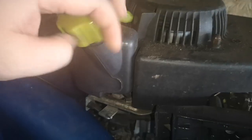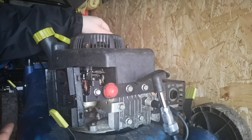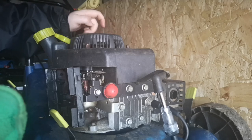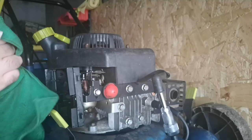So what I might do is put some petrol in and a bit of oil — it may have been tipped upside down. What we'll do now is check the oil, which is just here at the back. I'll check that, see what that's like. Looks like it may have been tipped up, it needs a good clean up as well. Just going to wipe it off, put it back in. See if we've got any oil in here — it's on the minimum mark, so I'm just going to add a bit, just to be on the safe side.